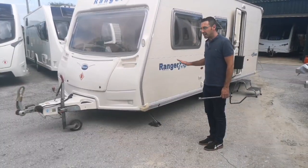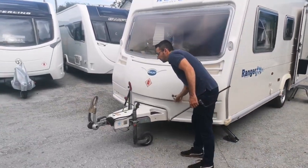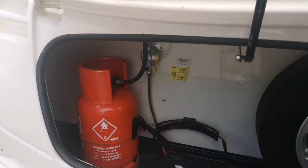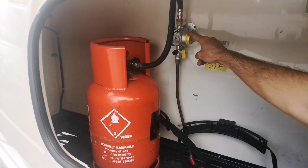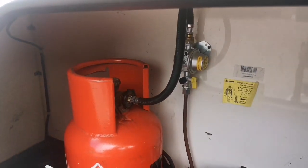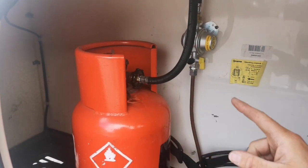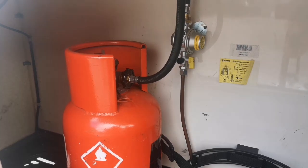We've now got our legs down. We're going to go to the front where we've already made sure that all of our gas equipment inside is turned off, so we can now turn the gas bottle to the on position. This is the regulator and this is the pigtail. It's set up for red bottles - the propane gas - and what you have to remember is that this is a reverse thread. You don't need a spanner with this; we've put a quick connector on there which you can just do up hand tight.